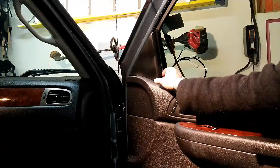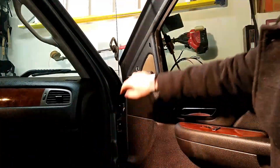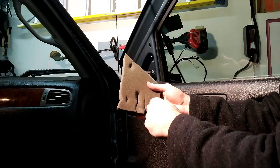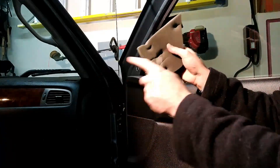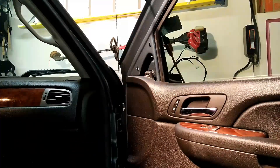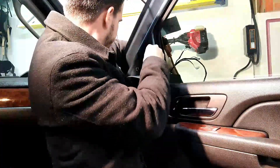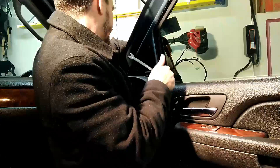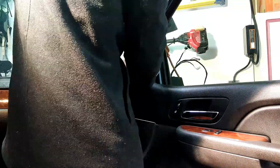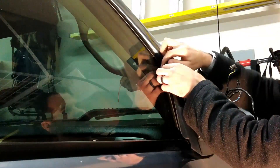Now we're on the inside of the truck. I'm going to take off this plate here — I'll do it with my hands since I did it before. Pull out this piece of foam here. It'll get stuck on the places where it goes in, so you don't want to rip — otherwise you'll rip these out, so be careful. Then I'll get a 10-millimeter and take those out. I brought both a ratcheting C wrench as well as a socket. I don't want to lose them, so I'm going to try to get my hands as far down in there as I can to catch them. That was the hardest one. Up here at the top, there is a friction pin, so I have to pull pretty hard to get that sucker off.